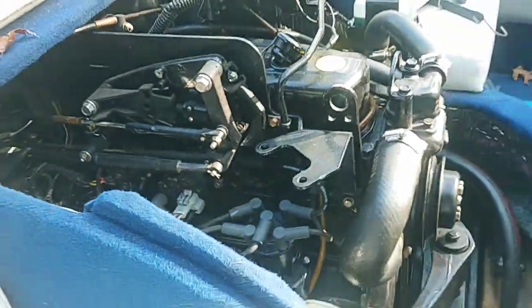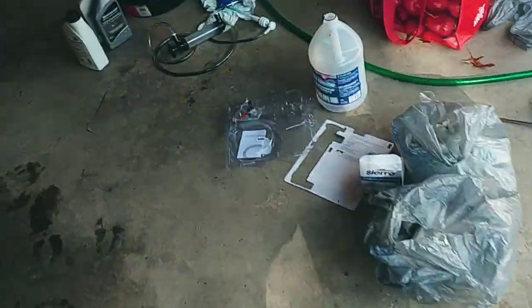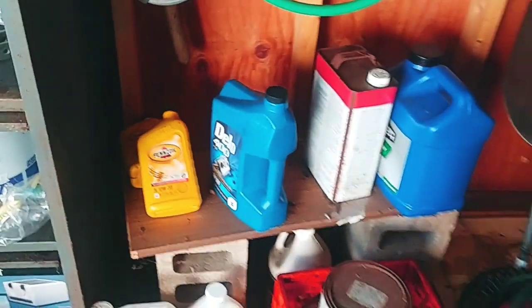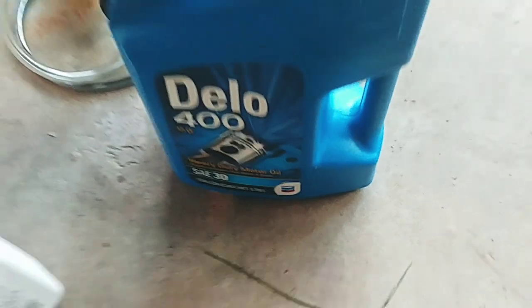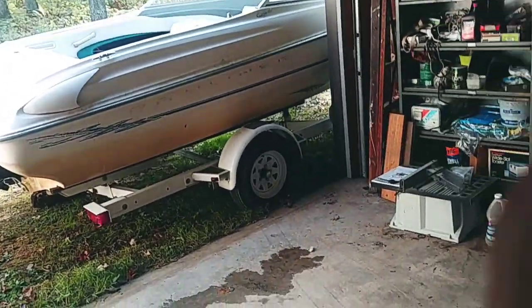The filter's in. I loosened the cap up there to make sure any oil in there comes out. I went ahead and took the drain plug off the bottom and just put a couple of bags down there with some rags — really didn't catch that much, there wasn't much down there. That was maybe the cleanest oil change ever. Now I'm just going to put some new oil in. This takes regular SAE 30. I'm pretty sure it's four quarts. I'll use the small container so I can put the old oil in the bigger one. The dipstick says it's full — I'm going to run it one more time because it has a new filter. The filter will soak some up, then I'll check the oil again and top it off if needed.